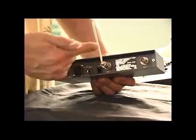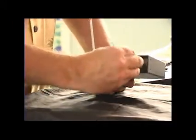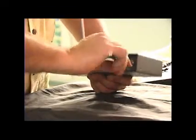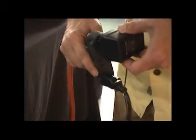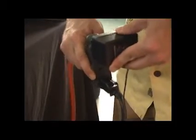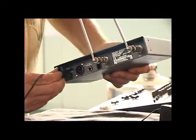The first thing to do is plug in the receiver's antenna, and they just clip in. You'll see a little slot, and they rotate in and clip in on both models. On most microphones, that's how they work. It's fairly obvious how to put them in. Then you want to plug in the power. Make sure you use the right power adapter. You can blow out your microphone's receiver right away by using the wrong power plug. So make sure the names match the model. Then you plug in each end, one into the receiver and the other into the power cord.